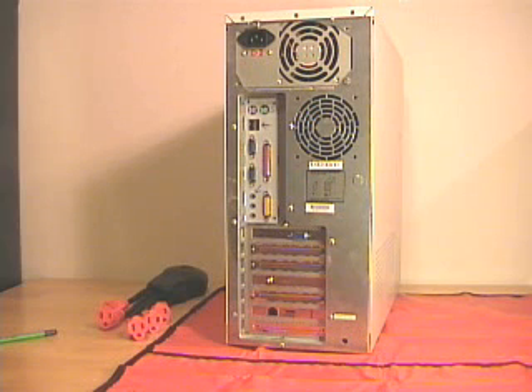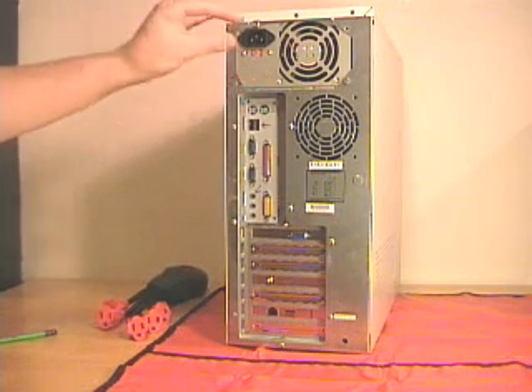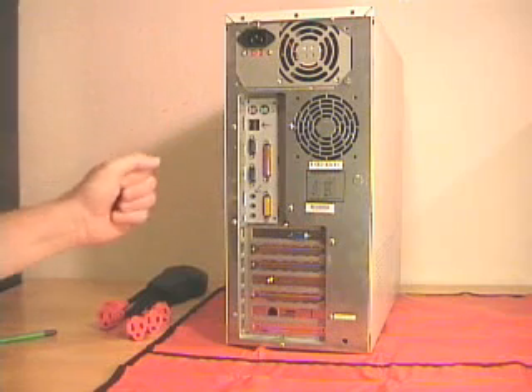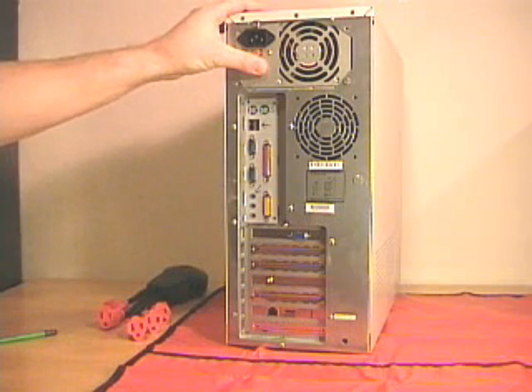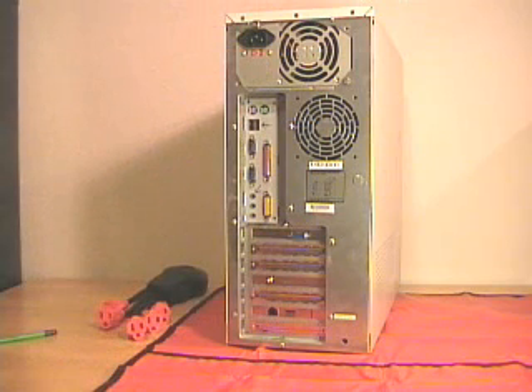The third anti-static measure I would recommend you only use if you're in a situation where you don't have any other anti-static devices such as a wrist strap, or you don't have a computer that has a main power switch on the power supply. In this case, before I would work on anything inside the computer, I would touch the power supply and the chassis. What this does is it equalizes the charge between myself and the computer and will lessen any chance that I will have any ESD built up. Although you're not truly grounded, this is one way to equalize and make sure that you're not going to produce any ESD charges. I would recommend you only use this as a last resort.